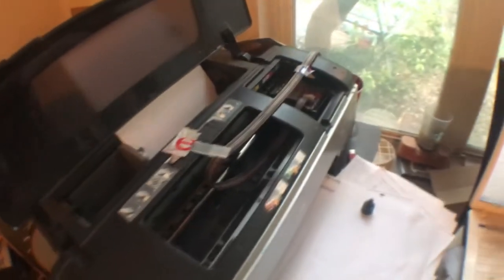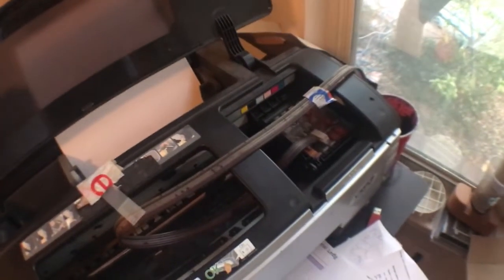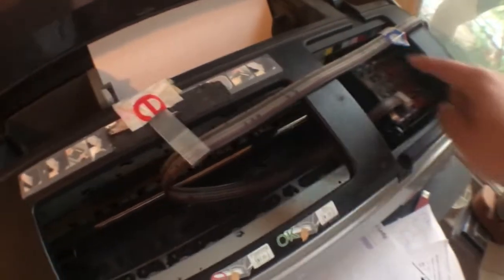You can easily save about a thousand bucks a year on ink. So right here I have the cartridges. What you're gonna want to do — which is very important — is look at these lines. Some of them don't have ink running through them, so the black ink is empty. What I'm gonna do is pop this little top right here, take that off, and bleed some ink into it.